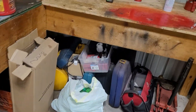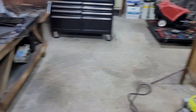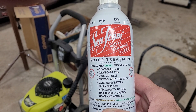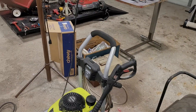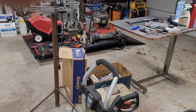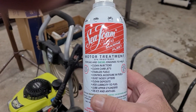When you're putting your pressure washers and lawn mowers away for the winter, use Seafoam. Add an extra ounce or two to a full tank of gas and run that for a few minutes so it can circulate into the carburetor. 98% of the time when you get it out the following year, she's going to fire right up. Very few people have problems using Seafoam.